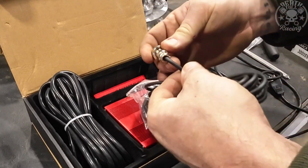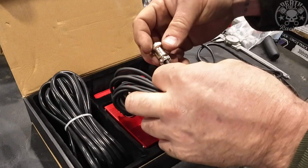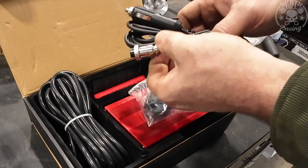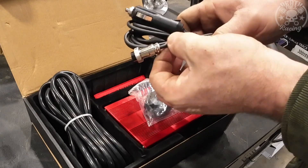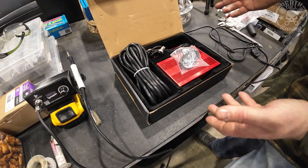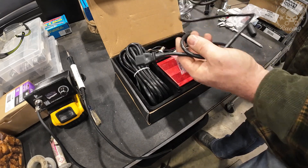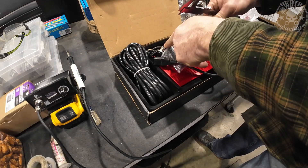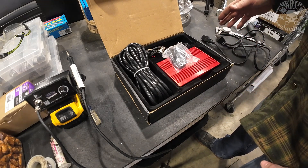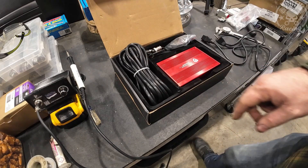The second thing I don't like is the cord is not actually being clamped by the clamp on this connector - it's completely held in by either the crimp or the soldering. I'm going to fix that. It doesn't really matter if you're not pulling on it, but I'd like it to actually work. I'm going to put a little bigger cable in. I'm not using the cigarette lighter part anyway, so I'm going to repurpose a computer cord. This is stranded wire, just like automotive wire, and after measuring it up, this will actually get clamped in there where the original cable doesn't. One conductor won't be used, but that's okay.